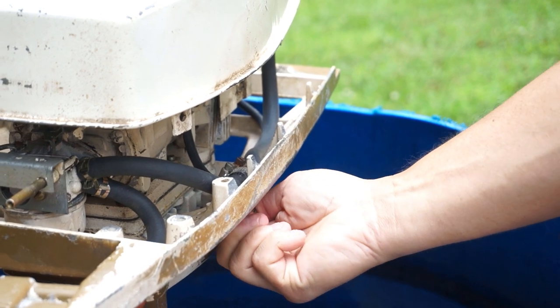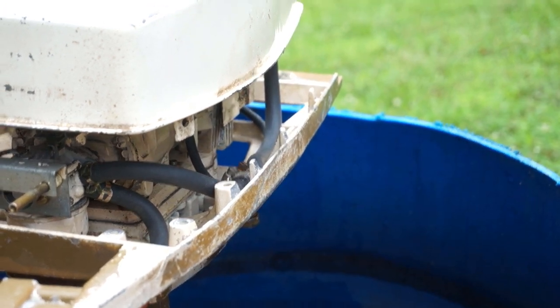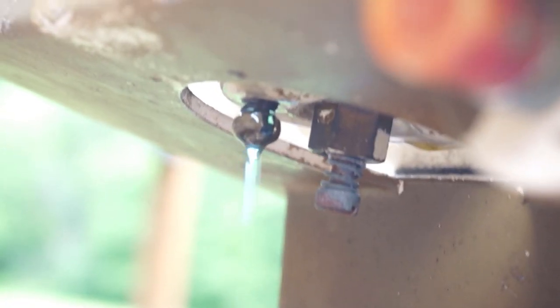So let's turn on the cutoff valve and see if we've got any leaking. I haven't even opened the cutoff valve yet and you can already see the carb drain is leaking — we knew that was going to be a possible issue. Let me see if we can readjust it. Maybe we can get it to shut off just for now. It's really leaking. Well, we know there's fuel getting to the carb, but the other problem is the shutoff is completely closed, so that's not working.